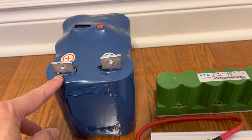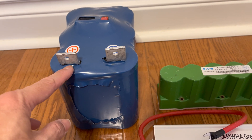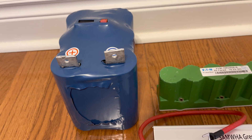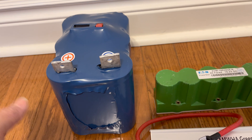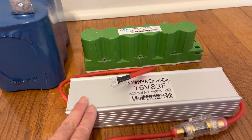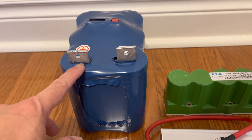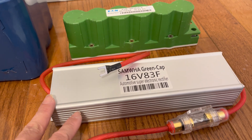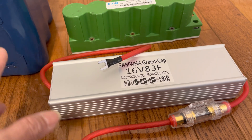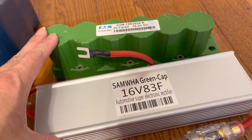However, modern cars have electronics such as an immobilizer, radio, and clock that constantly draw a small amount of current from the capacitors, so they cannot work alone unless you connect a solar cell to continuously charge them at about 1 amp. The smaller packs have a 100 amp peak for two to three seconds, while the large pack may reach around 1000 amp peak for two to three seconds. Sustainable current is about 10 to 20 amps before dropping below 8 volts, at which point there's not enough to crank. The two smaller capacitors are very close in performance for sustainable crankable current.